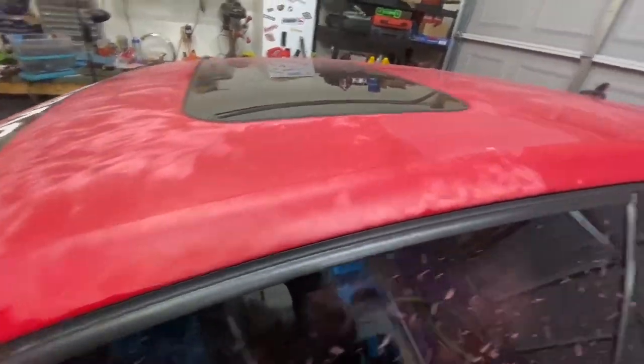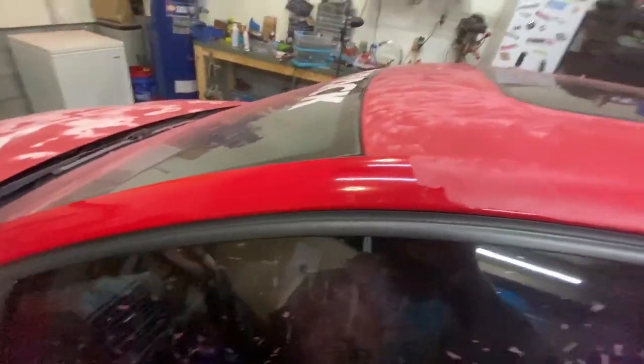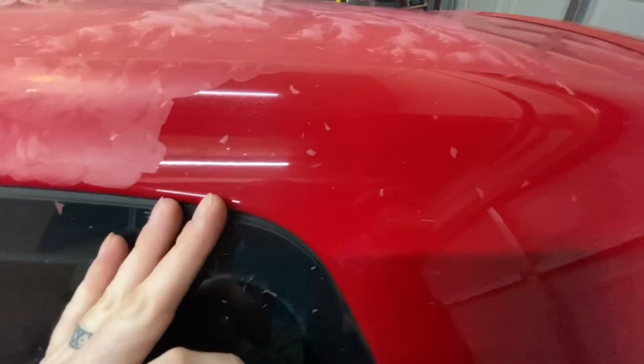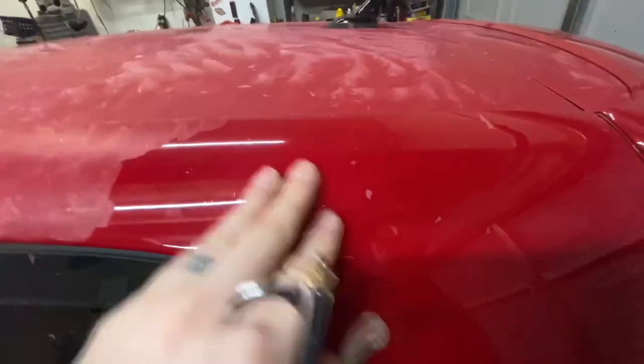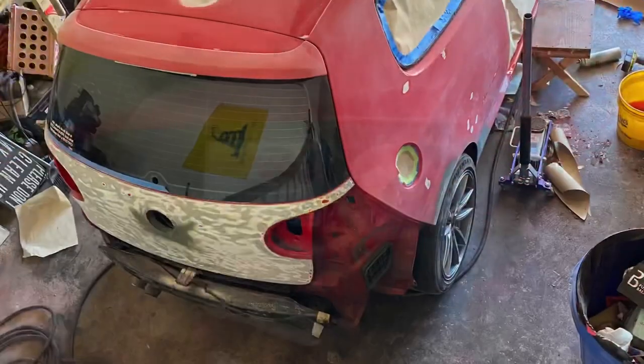The roof rails wanted to come off too, so I'm pretty much just using the whole logic of: if it's gonna blow off, take it off. The only real exception is this back quarter panel — when it's been repaired before they blended the clear coat, which is something you should really never do because it'll usually cause a failure where that clear coat is really thin. You can see the bubbling right there, which I thought would come up a long time ago but never did. That stayed put, so we're gonna have to blend that edge down. Oddly enough the bad repair saved the clear coat.